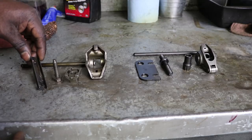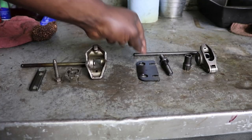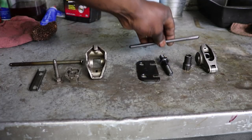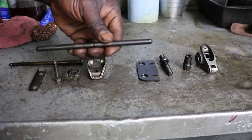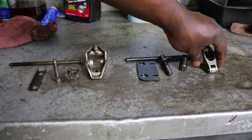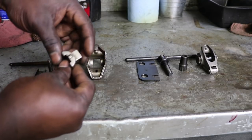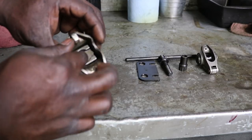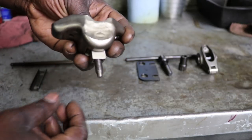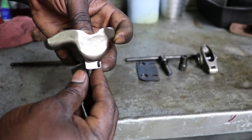This retaining plate stops the pedestal mount from rotating, and this is the guide plate in the stud mount setup for the push rod. This is a stock push rod — it has little balls on the end with a sleeve, kind of a two-piece setup. This Trick Flow hardened push rod has a thicker wall and is a lot more sturdy. Then they have a nut with a poly lock for the stud mount setup, and obviously the steel roller rocker. The pedestal mount assembly goes together like this — the bolt goes through the plate and mounts on the head. It looks good, is very stable, easy to adjust and set up, but not very strong.